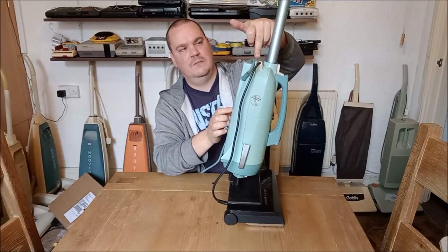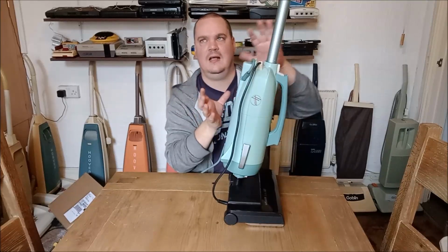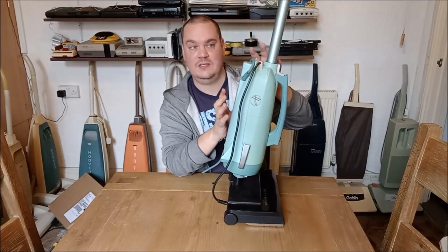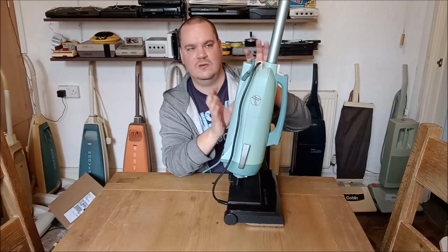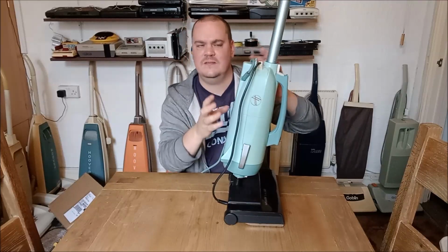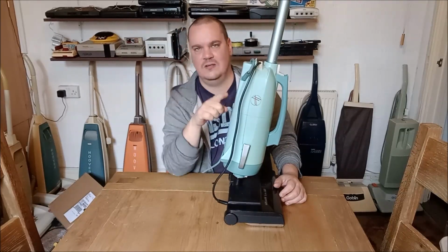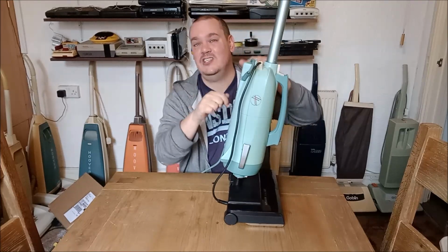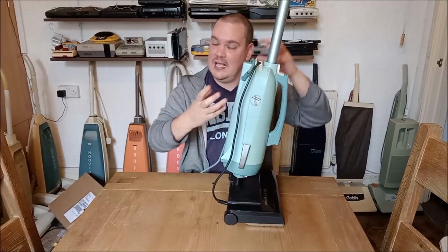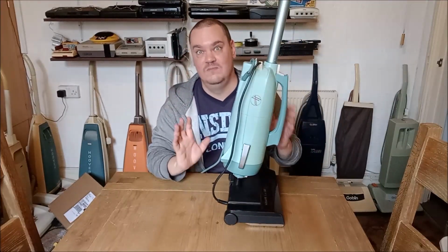So that then goes into the motor compartment, and then I drilled a hole inside here to run the cable through, because, how can I explain this? It's very hard to work on these because you have to get everything ready at the same time. The wiring and the terminal block and the motor all had to be ready to go in as one piece, because you can't take it out in separate sections. And it was even harder with the wiring for the Turbo 300 as well, to run it into the right place, to get the terminal block to sit properly, to get the connections in the terminal block, to get the switch connected, to get the motor connected, to get the wiring and the terminal block and the motor in together at the same time to sit in the right place so it all sealed up. It was very, very difficult.